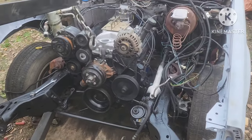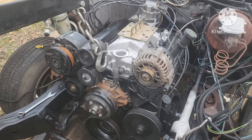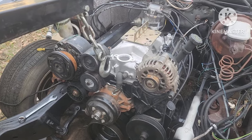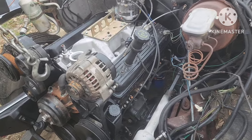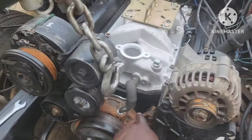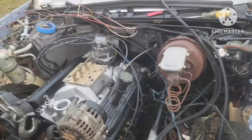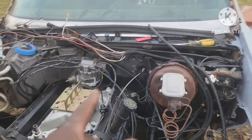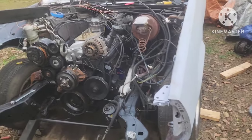We're back — y'all can see the motor is in! 350 Vortec with the Summit 8802 part number roller cam, full roller motor. Went all the way through everything, put it all back together, and it's mounted on the frame with motor mount bolts going through on each side — she's in there. I just gotta get water pump gaskets, thermostat gaskets, hook up the PCV valve, put a carb on it, and next I need to source a cross member.